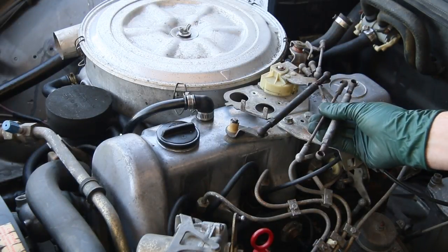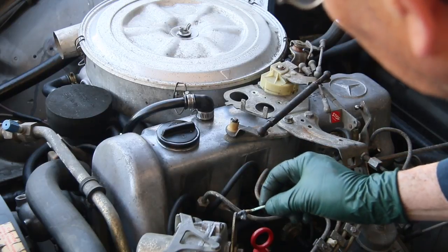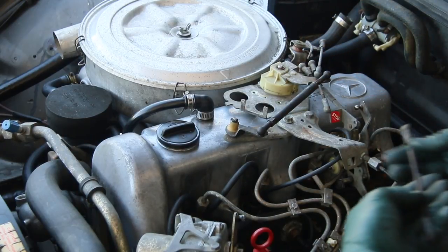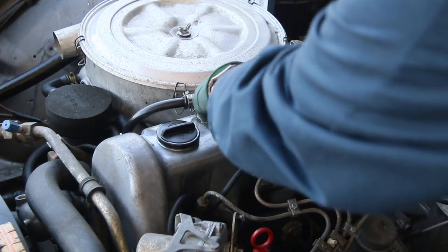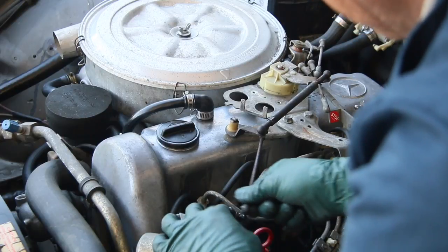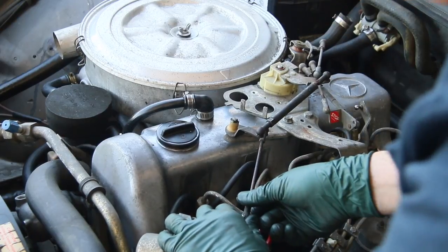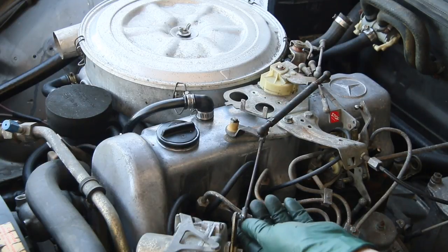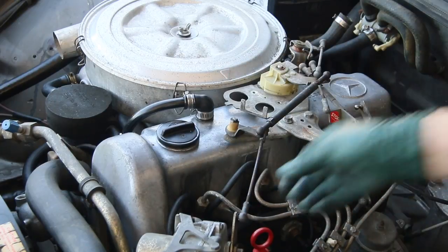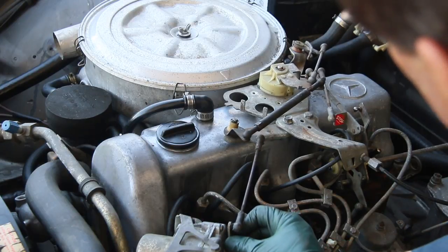You never know when you might need some old parts you pulled off a car — probably 10 years ago — but I was able to find two linkages in a lot better condition than the ones I removed. What happens is that spring clip down in there gets rusty and it won't release the pressure, so a little grease in there and a little vibration will get that loosened up. As long as I get it on — if you have to force it too much to get it on, don't use the ball socket, it's probably shot. All right — from here to here I have a lot less movement and slop, as you can see right there as I move it back and forth.